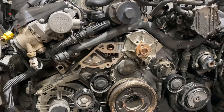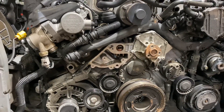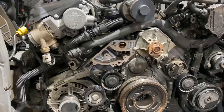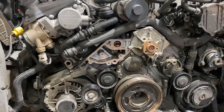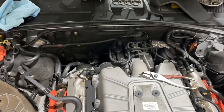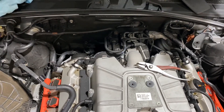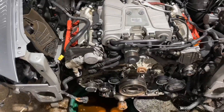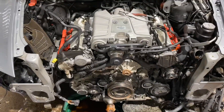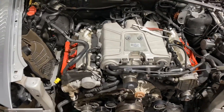The tool is pretty expensive, so you could use a very long drill bit instead. Just make sure you blow it out and clean it out thoroughly afterwards. Audi does not say to remove the catalytic converters — they just say to disconnect the mid pipe and have the water drain out of the cats. However, I would strongly suggest removing the cats, because there will be a lot of carbon sent down into them. To prevent damage to the catalytic converters, I'll take the exhaust off.